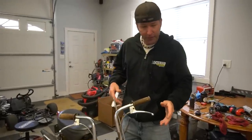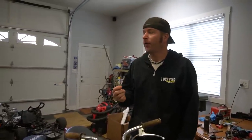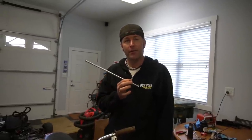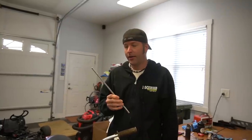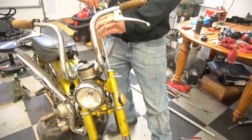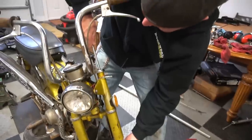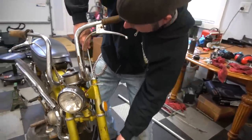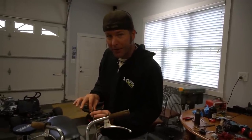Go with LEDs, that's right. As y'all saw, I was having trouble with the forks, but luckily Go Power Sports sells these tie rod assemblies. The ends go on the ends of the fork, it threads right into the end, and I'm able to pull up so I can thread the bolt in. That's what took us like an hour with mine — that was miserable. Call Go Power Sports for all your CT70 fork specialty tool needs.